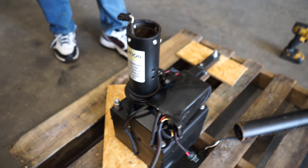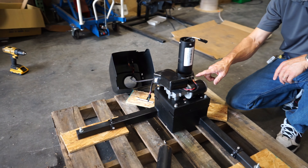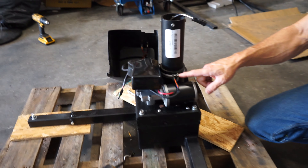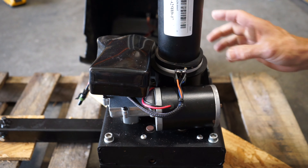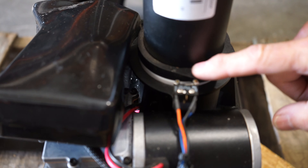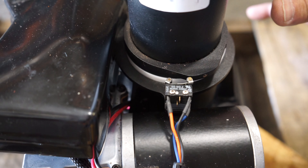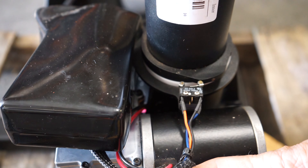What I want to make sure to show you — if you look on this side right here, there is a sensor. There are many sensors, there's two of them. Do not hit these sensors. This is how you adjust these rings — there's a little Allen wrench at the end of my finger right here. You can turn these rings to adjust how far the lift turns and stops. Do not hit these sensors, because then you're gonna have to have a whole new sensor.